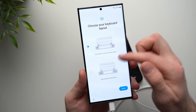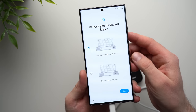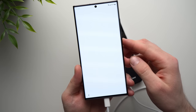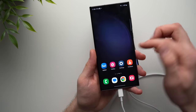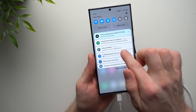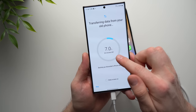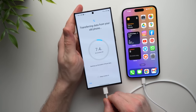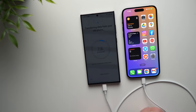Here it asks what type of keyboard layout you want — there's a more minimalistic keyboard and one with a bit more functionality. Choose whichever you want and tap Next. Now we're all set up, so tap Finish and it'll take you to your home screen. Your phone is now pretty much usable — you can scroll around, play with apps, and change settings. But keep your phones plugged in because the data transfer isn't complete yet — it says about 30 minutes to go. Make sure you don't disconnect your phone, but your phone is usable. Just put it down, take a break for 30 minutes, and when you come back all of your data will have been transferred from your iPhone to your new Samsung device.